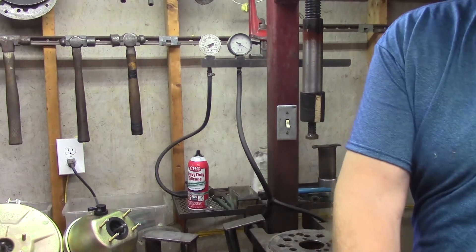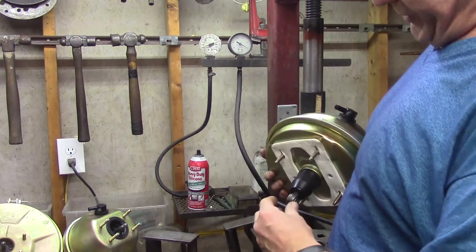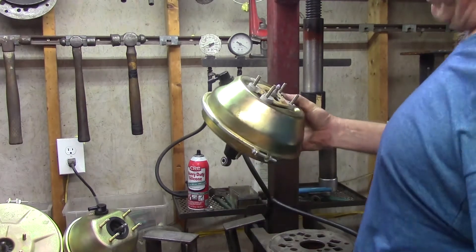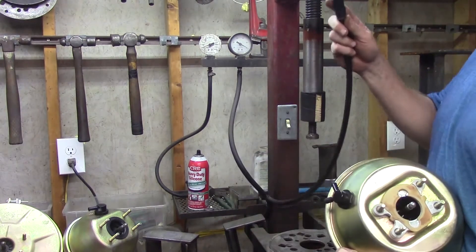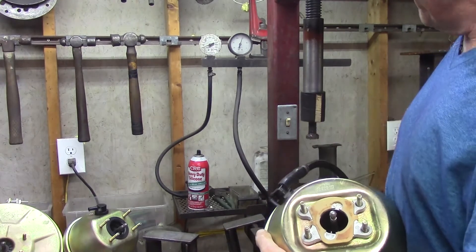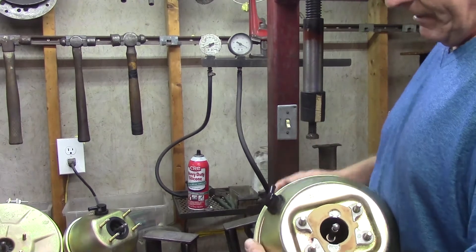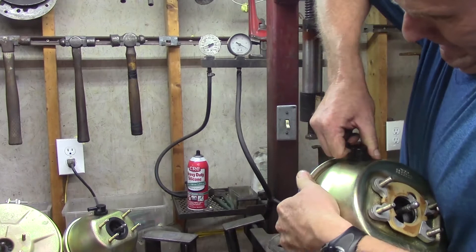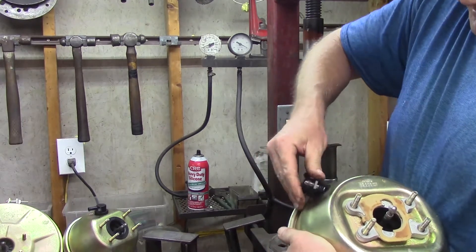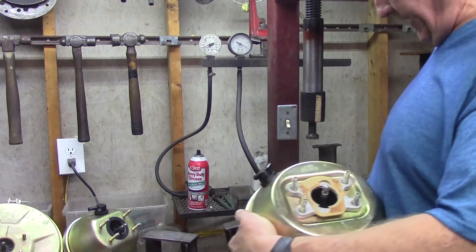You can do a field test. You can, but I tell people you've got to isolate a unit in order to test it. So you can unbolt it, make sure that the pedal linkage isn't pushing against it and making it bleed off just a little bit. The way you test anything is you isolate it. Now we've taken the booster off the car — you can fire up the engine, take your little vacuum hose or extend it, and you can do this stuff at home before you send it off to me. Stick your vacuum on there, get some vacuum, take that hose off, and let it sit there for a minute. If you pull that check valve after 30 seconds or 45 seconds and you hear that sucking sound, common sense tells you that the can holds vacuum.